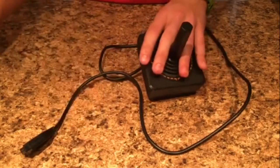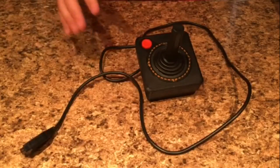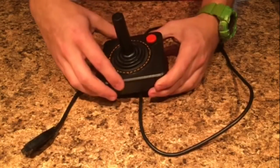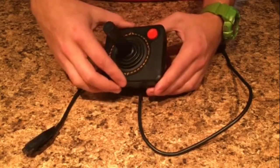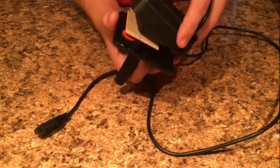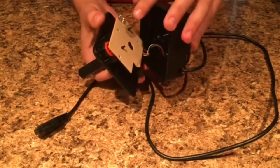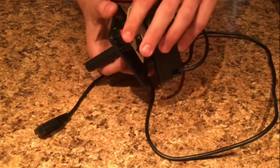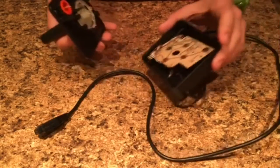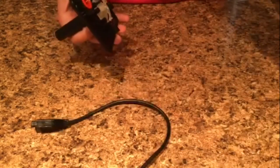This should be a lot easier than doing that giant Magnavox Odyssey 2 I just did. Go ahead and lift the top off — you will have some resistance and the button will fly off, so you may want to turn it upside down. The motherboard has little plastic cylinders holding it in place; slide it off and it'll stick to the bottom half. The bottom half is not washable and you can't remove the motherboard, so just move that aside along with the cable.